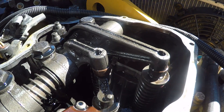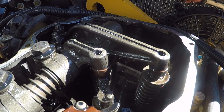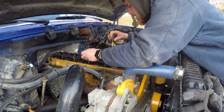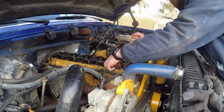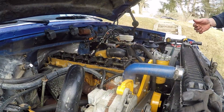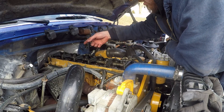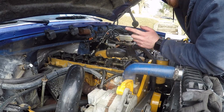It's basically you just go finger tight with the screwdriver and then crank it down. Once you get done adjusting them and tightening down the lock nut, go ahead and torque them down to 22 foot-pounds or 264 inch-pounds. Alright so that's it for cylinder one top dead center. Now we're going to roll the engine over 360 degrees and that will give us cylinder six top dead center, which will give us the adjustment for the rest of the valves. Don't forget to pull your pin before you try to roll it over.